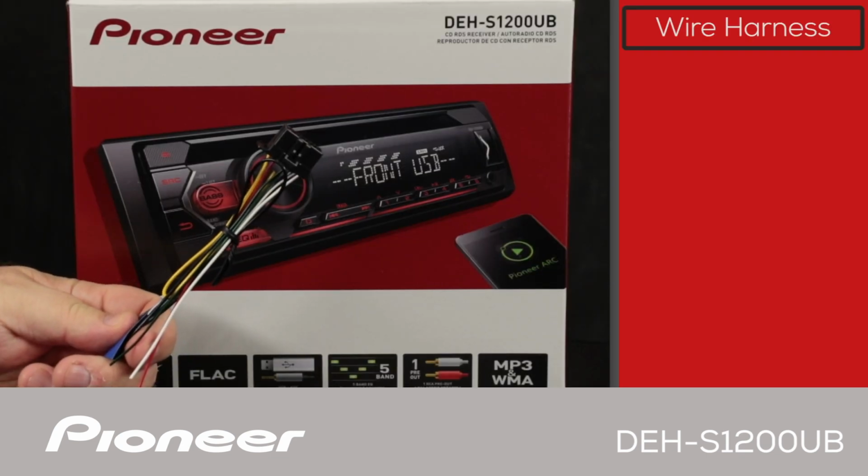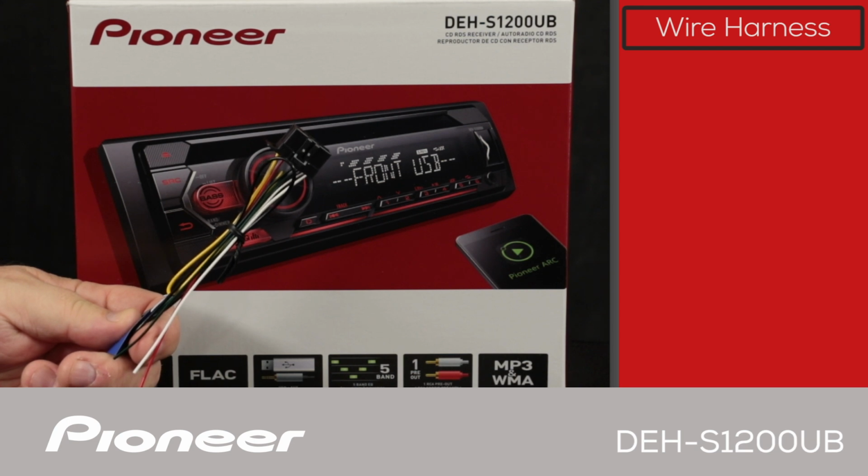So this is the electrical wire harness, and we'll make all of the electrical connections from the in-dash receiver over to the vehicle through this. Connections like power and ground and speaker connections, that sort of thing, all happen through this.